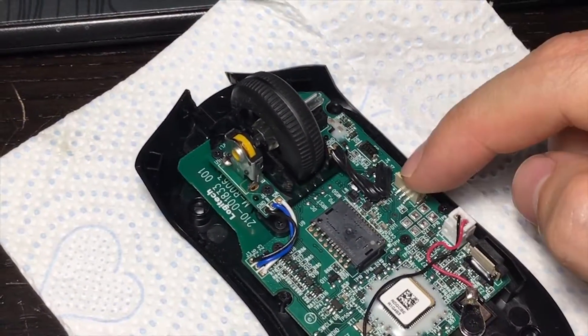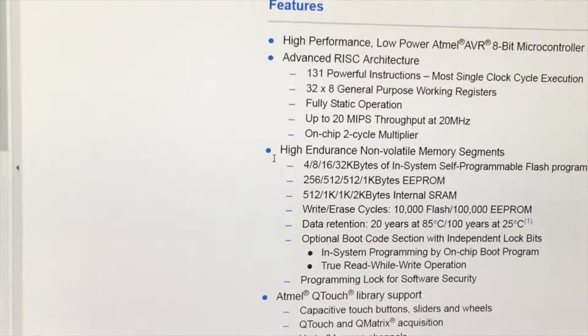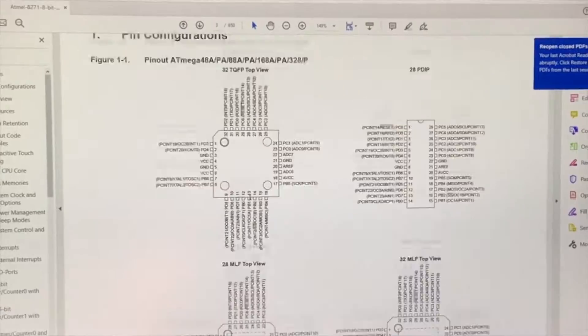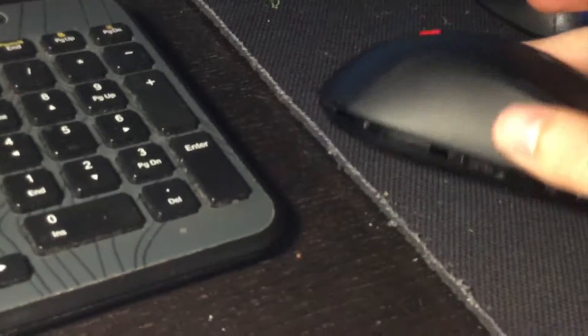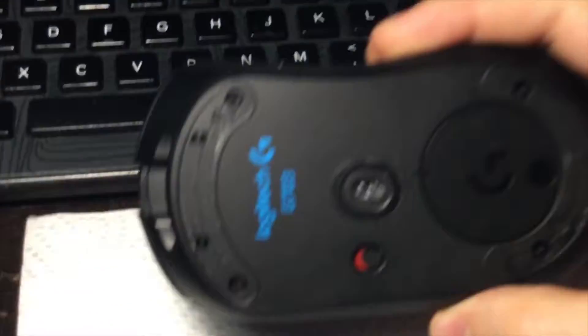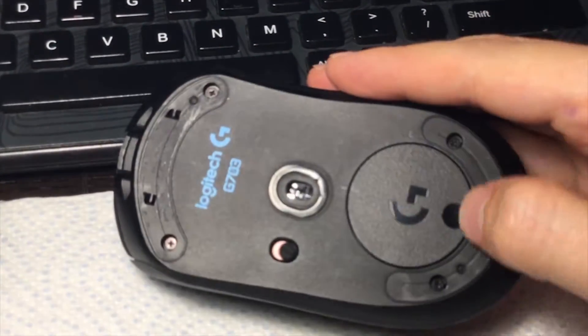Now install the battery, connect the battery, screw down the battery, and put the cover over the wheel. There's the mouse — you can see it's working. Let's scroll for the first time — look at that, that's a perfect scroll, no going up, just going down. Let's go up — yes, scrolling exactly the way it should be. Also before you actually seal the mouse, ensure all these buttons work and that the blue flex cable there is connected correctly.